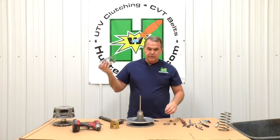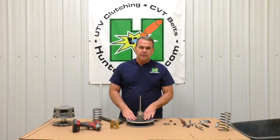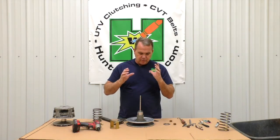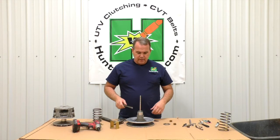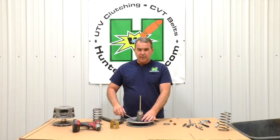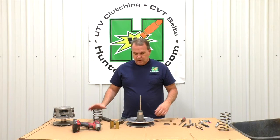Take the nut off. Basically you're just hitting it right on that edge of the spring retainer. If you're changing springs, take the whole spring out. If you're doing slippery washers — we don't have slippery washers for X2/X4 today but we do for Rhinos — put the spring in now if that's what you're doing. If you're taking this apart to clean it, we have another video for that. You'd simply pry this spring cup up like I'm doing right here — it pops up — then get the pins out and follow that video.